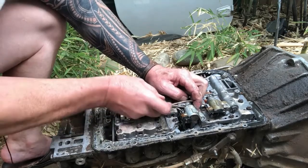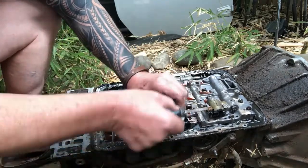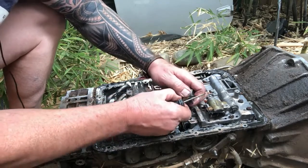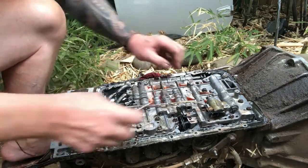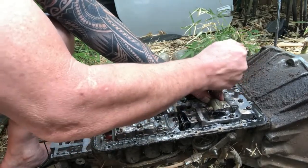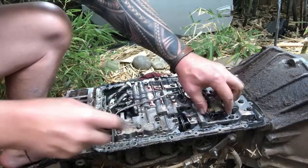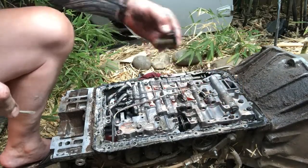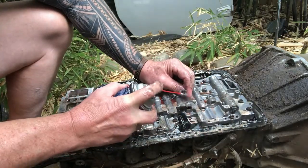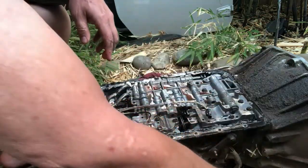It's the same thing — a little lateral movement with a screwdriver, not too much because there's a rubber o-ring on there. I wonder how good these things are going to be after all that gunk. Same thing — let's get it off. These are sometimes a little rough to get out, but this thing's probably been in here for 30-32 years — these are the original factory solenoids. I like to spray a little contact cleaner on the ends and clean them out a bit.